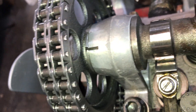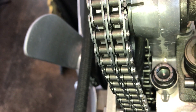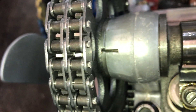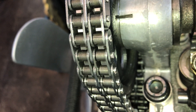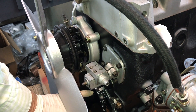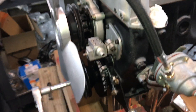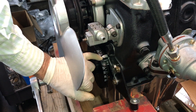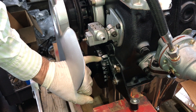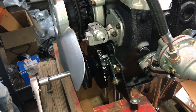Back on the marks. If you want to see how far off the cam is from the crank — you can see that mark is not perfectly lined up. So what I'm going to do is line it up as perfectly as I can, then come down here and read on the crank how much off it is. It's off about — there's five degrees right there — so it's off about three degrees, which isn't enough to worry about.